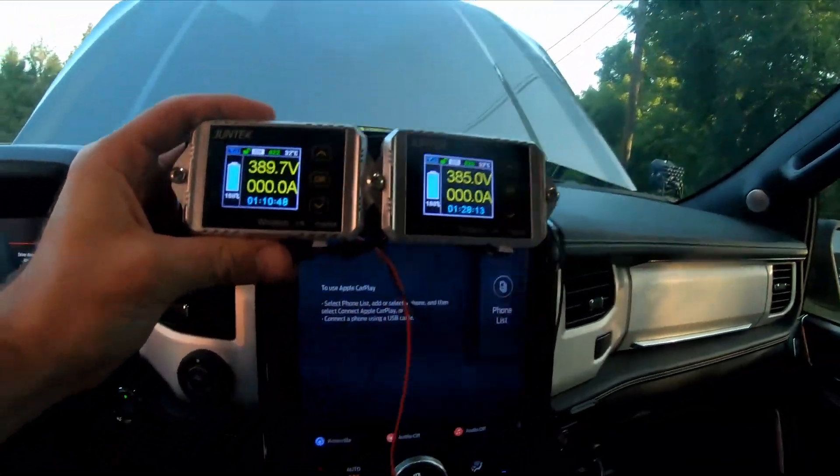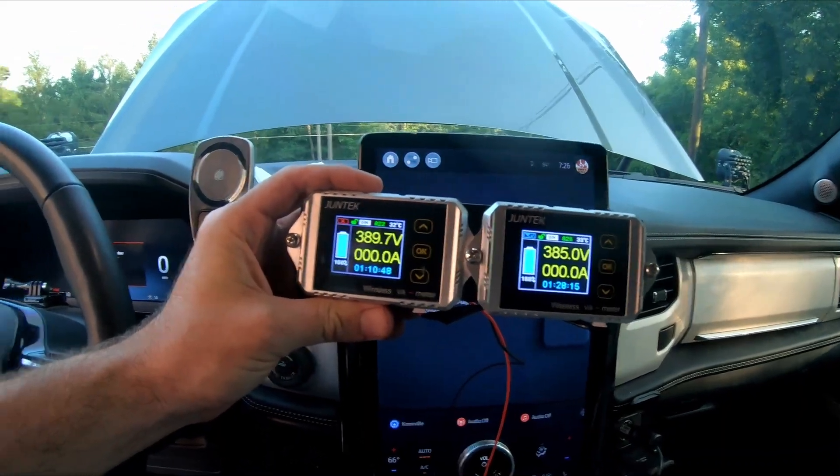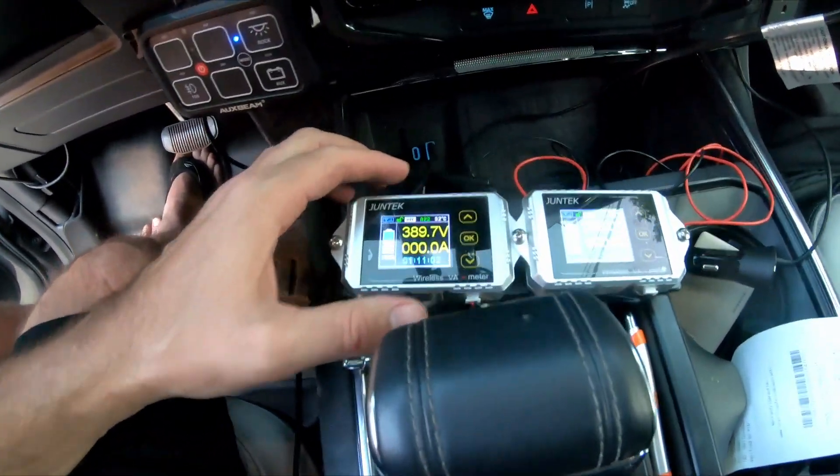All right, I got it. It's crazy hot like usual, but I've got them all connected and they are all working now. All it was, was a bad connection in the Anderson connector — the brand new Anderson connector on the truck side. So I've got those connected.